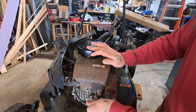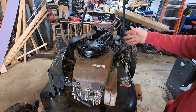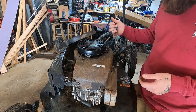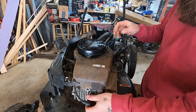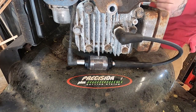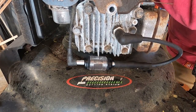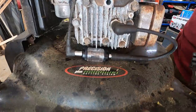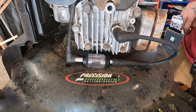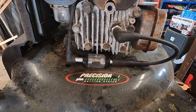So I think what we're going to do on this one is put it back on the side of the house and tackle that yard machine instead. I'm confident this motor is good - I'll bet you what happened is this broke and somebody just parked it out behind the shed for several years. It's got compression, so let's find out if it has spark real quick. I got one pull out of it. Let's give it one good pull and see if she's got any spark. I saw it had spark, so cool - this motor's a runner, just not for this video. I gotta wait until I can find a Briggs and Stratton recoil for it.